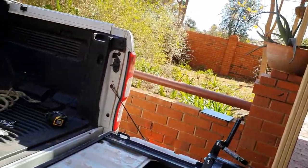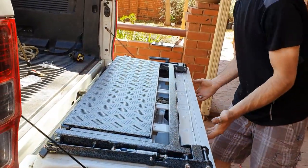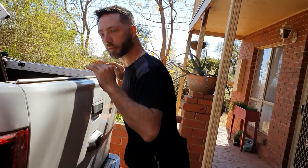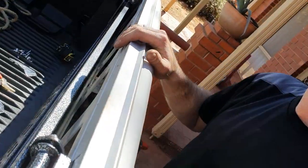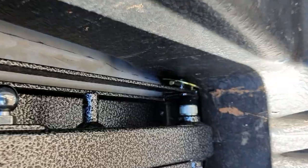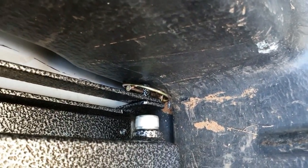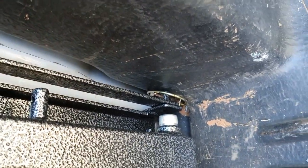I'll put this first tech screw in and see if this works. Tighten that down with a screwdriver. Now I should have an exact 1220mm from one side to the other no matter where I measure — and yes, a lovely 1220 there, that's fantastic. So now in theory this will clip up, and in theory this will close — the tailgate closes! There's heaps of clearance all the way around. See that little pin — see how close that sits to the edge of the tub. It's pretty damn close, but it does fit, and that's all that matters. Now let's put all the rest of the bolts in.